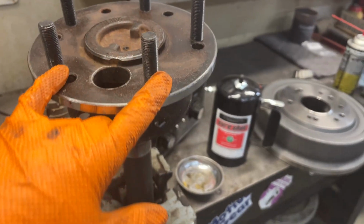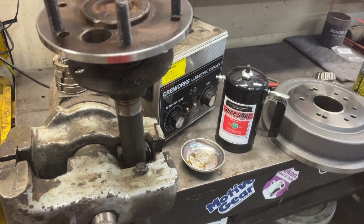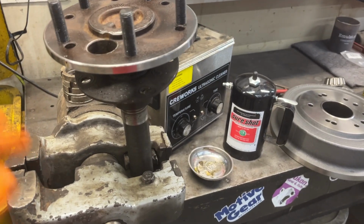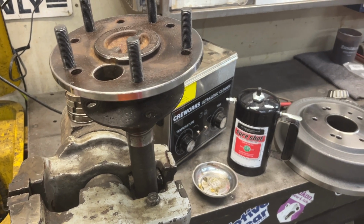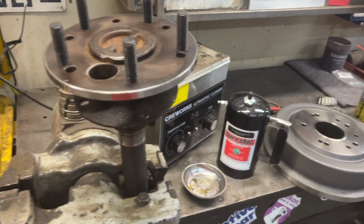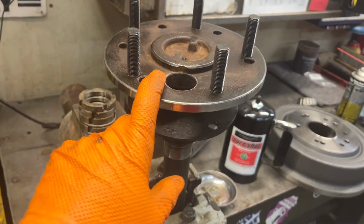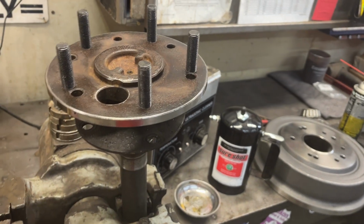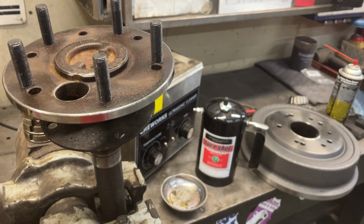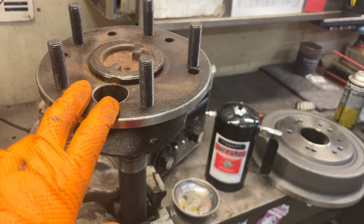So first things first is the axle shafts themselves. So what I did is these are 6-on 5.5 bolt pattern, and they take an 11-inch brake drum. Now you could also say, hey, you could convert this over to disc brakes. Obviously you can do that, but again, you're going to still run into the problem if you want 5-on 5.5 bolt pattern. So I sent these down to Dutchman Motorsports in Meridian, Idaho. Highly recommend them for any of your axle shaft needs. Cutting and resplining, re-drilling, anything like that, they're great.